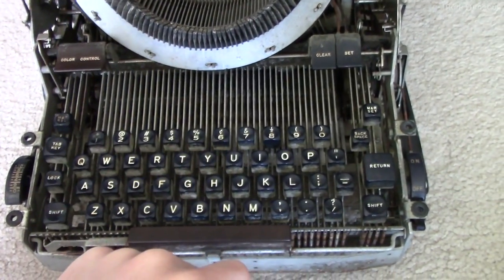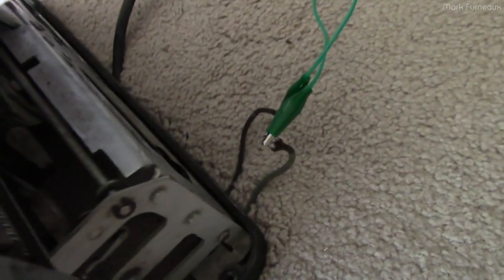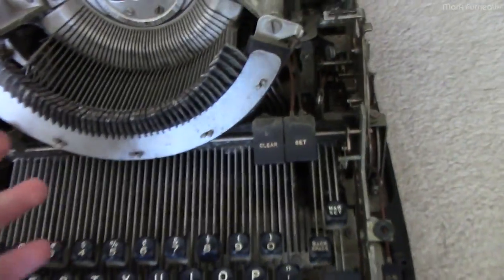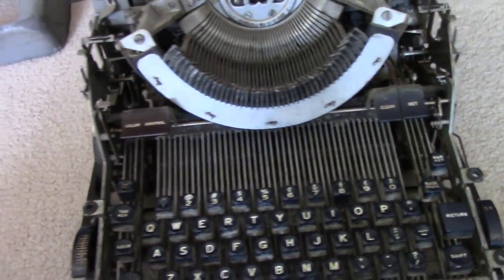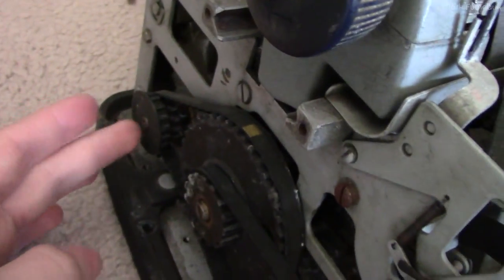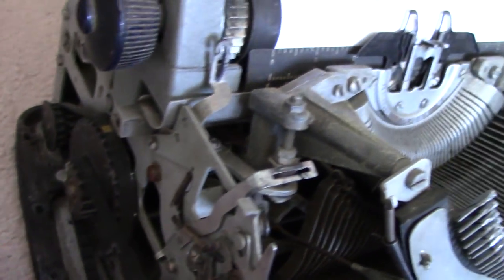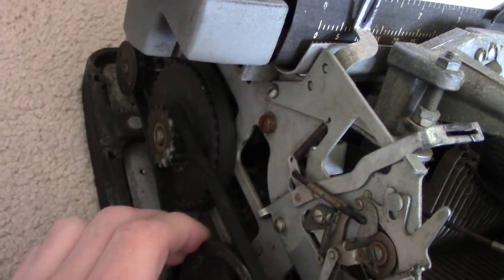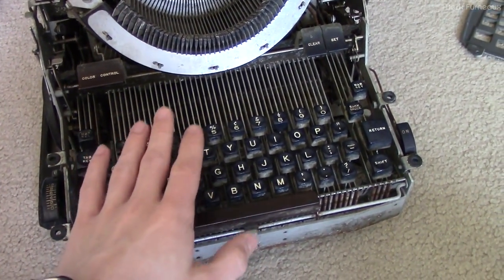Once I found the power switch was open circuit, I basically just took it out of circuit and hot-wired the thing - a little jumper with the two wires from the ends of the power switch. I ohmed it out - there was 45 ohms between the two, which was obviously the stator winding. I brought it up on a variac and it came up just fine - the motor starts spinning. The motor is located back here and these belts are actually in pretty decent condition.